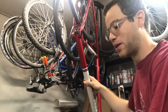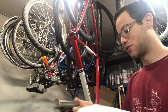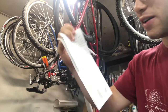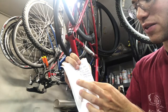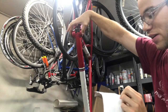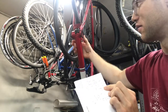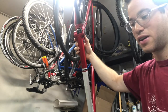The two types of bottom brackets you have are called English thread or Italian thread. With English thread, you have the length of the bottom bracket and then the diameter of the bottom bracket. For English threaded bottom brackets, the length — this part right here — is going to either be 68 or 73 millimeters. And if it's Italian, it will be 70 millimeters. So that is probably the easiest thing you can do to immediately tell whether or not it's English or Italian thread.